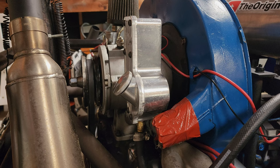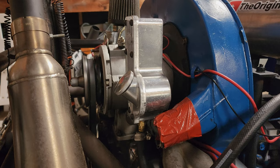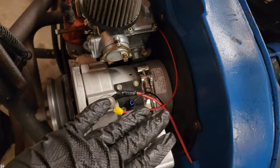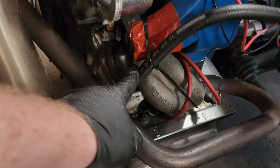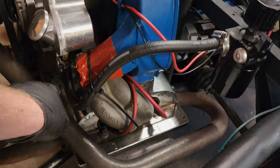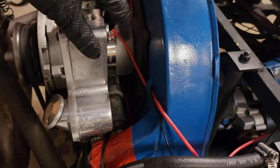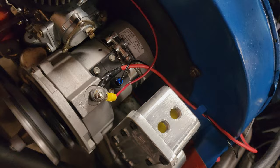I'm fairly happy with that, so let me grab the key. We'll fire this thing up and see how much air we feel coming out of that dude. You can definitely feel the air coming out of that. Just putting my hand over these wearing a glove, I could feel the air coming out of these vents. Before I did this project, the only vent I had was this hose running out of the alternator stand into this catch can — just this 3/8 hose was it. We still have that, and it's at the bottom, so any oil that does come out will in theory push this way. But I've got this extra vent, and the third one up here. There's some work to do here, because this is definitely not what I would consider finished, but it's a step in the right direction.